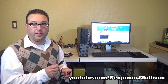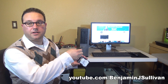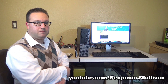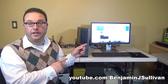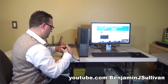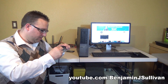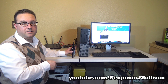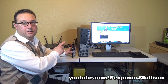Allow me to demonstrate. Here's the USB adapter and here's the laptop hard drive. I'll plug it in and connect it to USB, and the computer is going to detect it. You hear that? A window popped up letting us know there's data on the drive. I'll go ahead and eject the drive. Now let's see what happens when I try to use the desktop drive. The adapter physically fits, but when we plug it in — nothing. It's not spinning, the computer didn't detect anything, and that's because we need more power.